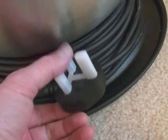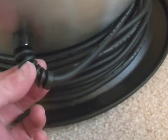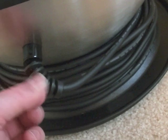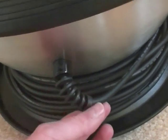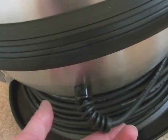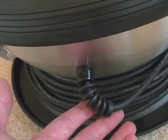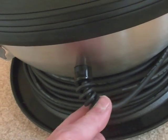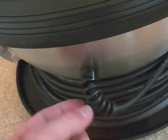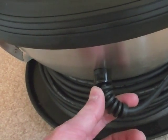This is fitted with the UK plug with a protector over the prongs for transportation, and it's got a very nice cord strain relief where the cord enters the cleaner — that should help prevent any damage to the cord. This is often somewhere a cord can become damaged because it gets constant stress. Often when I've had old vacuum cleaners that haven't worked, after rewiring the plug end I would check this part and pull the flex in a bit, cut off the damaged section and rewire it — and that often does fix the problem. But because of the strain relief, hopefully that will prevent it.